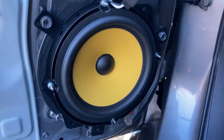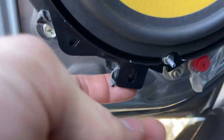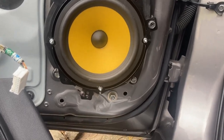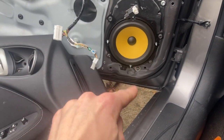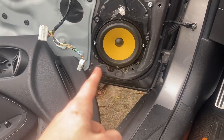And just like that the speaker is in. This one down here didn't line up too well so I used a bunch of 3M tape — it's pretty sturdy — and it has these two bolts up here that are perfectly good. I ended up coming back and fixing this speaker, cutting that piece and putting a screw in it because it didn't line up perfectly. It works, it's solid. I did that so it wouldn't start rattling eventually.